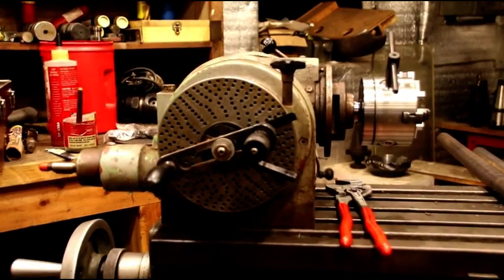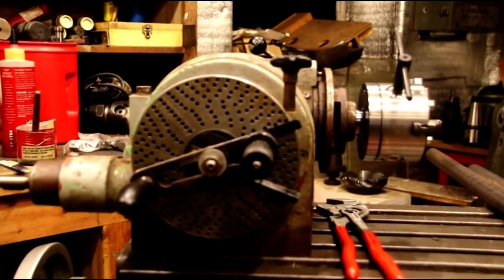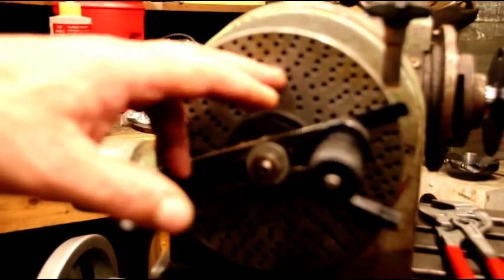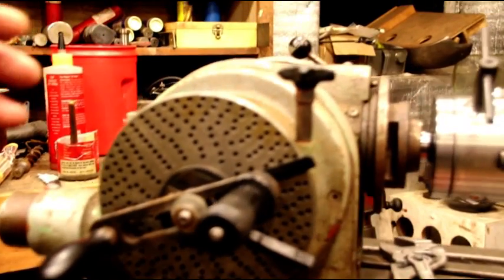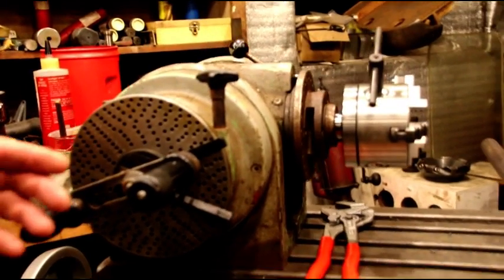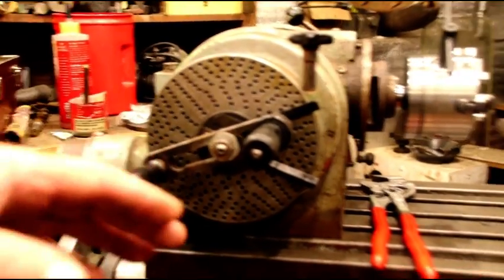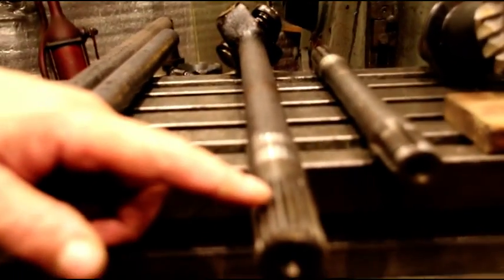The painting is done for the day and I'm just getting set up for those axle shafts while I've got a few minutes before the day is over. On this plate I do have a 19-hole setup. There are a lot of videos out there if you want to learn how to use a dividing head — there are guys that know a lot more about it than me. But I'm lucky enough to have a 19-hole plate. You could do it without that if you know how to do the calculations, but it's easier for me. That's going to cut this 19-spline that's going in the spider gears.